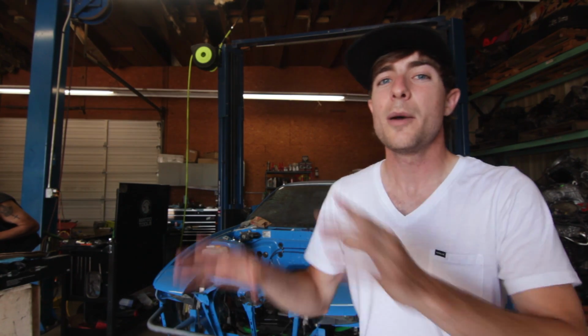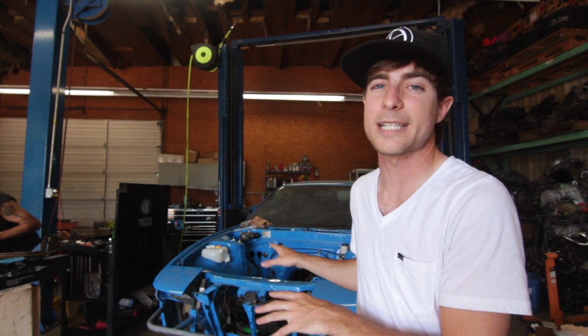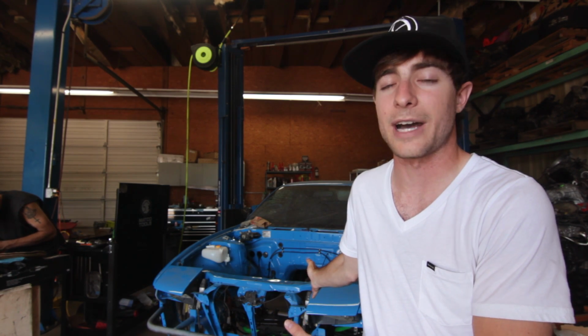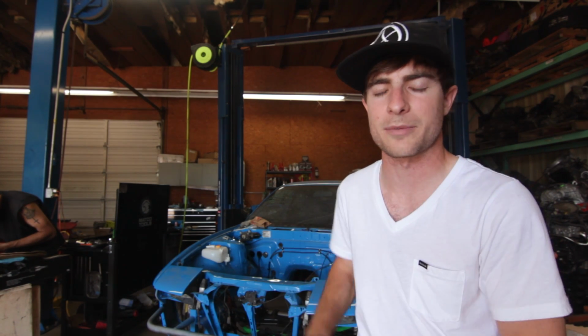The turbos themselves are like 550 horsepower capable as long as you use E85. But the car is going to be on primarily pump gas because it's so much easier, and I know that once I go E85 I never would want to go back to pump gas since I want to drive the car so much. We're using the stock ECU at first, driving the car, breaking in the clutch, breaking in the differential, all those things, and we'll probably make a good amount of power on around 14 to 18 pounds, and that'll be plenty in a car that's in the upper 2,000 pound range.